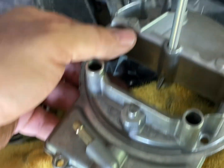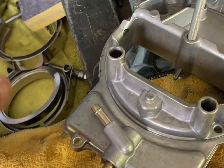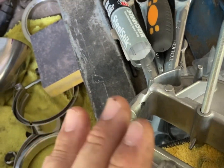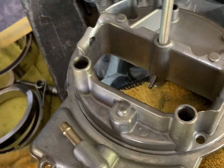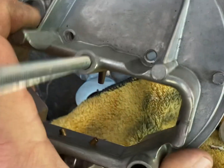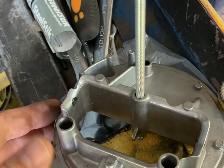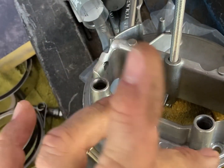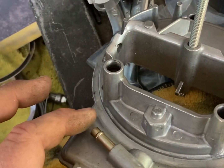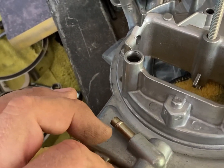So if you followed along all the way through the video, this is my method using some of that Hanger 18 methodology to getting a blow-through carb completed for boost. I didn't use a few of them. I'm going to reinstall the carb, and once I get everything fired up and the air fuel ratio gauge installed, that'll determine my next step. I will go ahead and block this vacuum here — put a cap on that — and I'll probably shear off these later depending on how rich or lean I am. This valve here has been reported you don't have to address, but it does leak, and there could be a vacuum pressure issue.